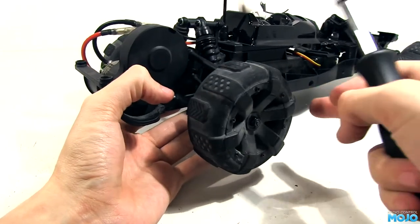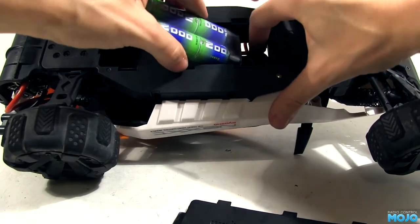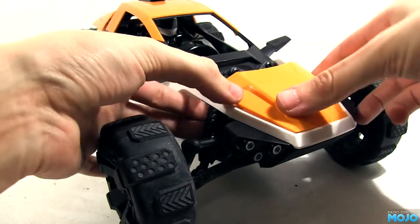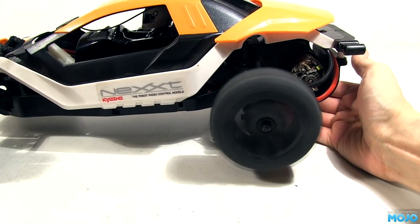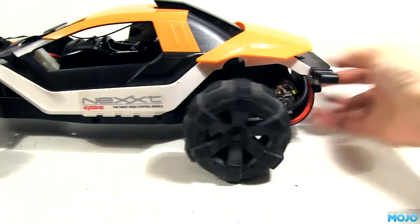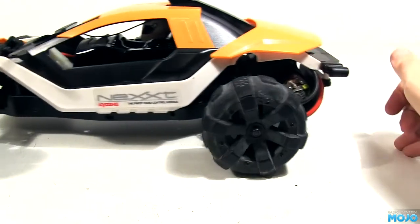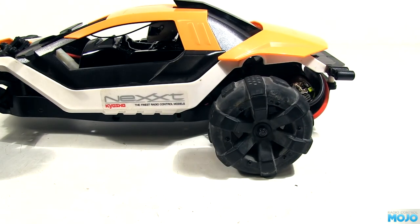The body gets fitted too. Of course we'll need a battery to test — good old NiCad. Still need to work out a better method of fitting that front panel; magnets still seem like the best bet. Radio on, buggy on, and it works. Sounds a bit rough, but that's the new brushes catching on the old comm — they'll wear in after a couple of minutes of steady running. Can't wait to see how it runs, but it's raining and set to be raining during every bit of time I might have to try it.